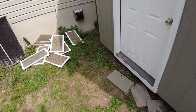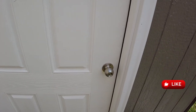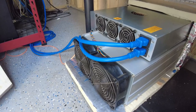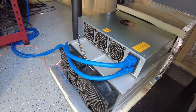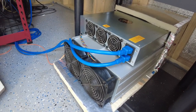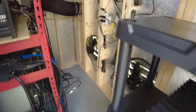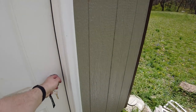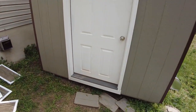A bunch of heat is coming out. Doesn't seem too loud. I have to get the keys to get back in here — there they are. It's not very loud, you know. I can see the fans are at 100%. I guess the bolt was screaming with the power supply, which is reducing the noise. But those fans are at 100% and that's as loud as it is — that's pretty damn good. I don't want to jump the gun, because I want to make sure the temperatures stay good. We are still at 88. I'm going to let this run for a bit. The Epic control board is running the voltage optimizer to optimize it to 90 terahash — I think I have that one set at that. So we're going to let that run for a bit. Jump to the computer and we'll be back.